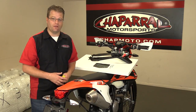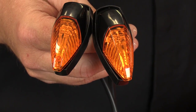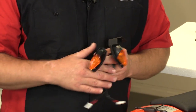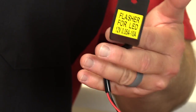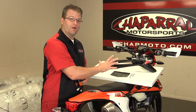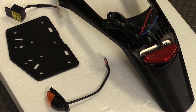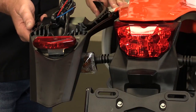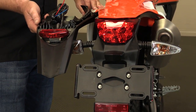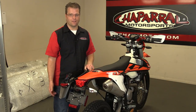If you're gonna be taking your bike to the street, you're gonna need to find a way to attach turn signals. Sick-Ass Racing has these amazing turn signals right here, and this here is the LED flasher that's gonna allow these LED turn signals to flash at the same rate as the stock incandescents. Now these two pieces do not come in the Ocelot Tailight Bracket Kit, because there are lots of people who want to just run the brake light tail light. But if you're gonna ride this bike on the street as it was intended, you need to put turn signals and a flasher relay in. So let's get busy.